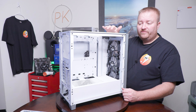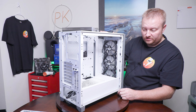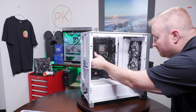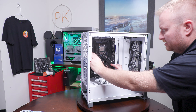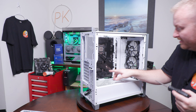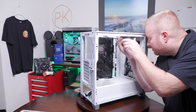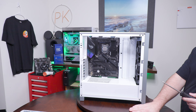We're just going to leave the RGB fans in it — I'm just not going to turn the RGB on. We're also going to add one rear exhaust fan. Let's get the motherboard set in here. All the standoffs should be where they need to be, we just have to line it up. That's going to look nice in there. I'm missing one screw because on the other case that hole is a post, so I'm going to use one from another spot. But there we go — motherboard is installed.